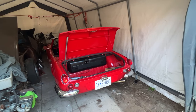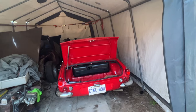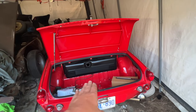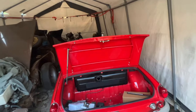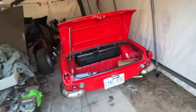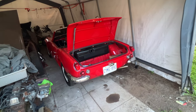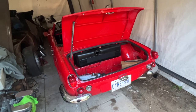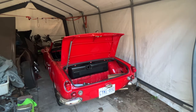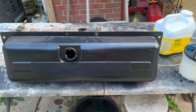After that we're going to rinse it for a while — maybe run the hose through it — then dry it and hope for the best. While it's out, I'm going to start the engine and make it run out of gas so the line empties too. While the tank is out maybe we'll disconnect the fuel pump and blow through the line to get rid of anything inside. I'm not going to keep you here for the entire process; I'll bring you back when the tank is out and we're ready to pour the muriatic acid.